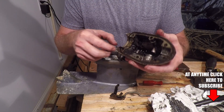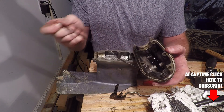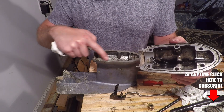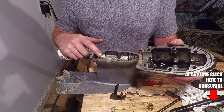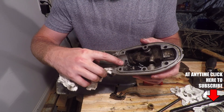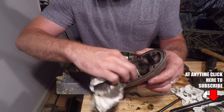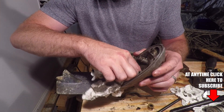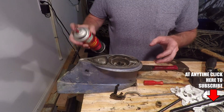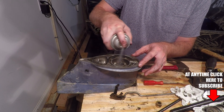One last thing: on the skeg, around the perimeter of the mating surface, is a rubber gasket that you'll need to replace. Go ahead and remove that before you start cleaning the surface. Once you have these surfaces cleaned off — I used a bench top wire wheel — there is a magnet in the skeg that collects metallic pieces from wear and tear on your gear train. Clean that off. We got it open, so might as well clean out all the metal debris it's collected. Make sure all the surfaces, especially where you're going to reinstall the new seal, are nice and clean.